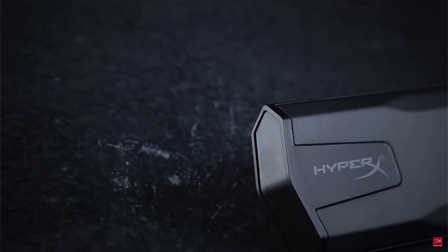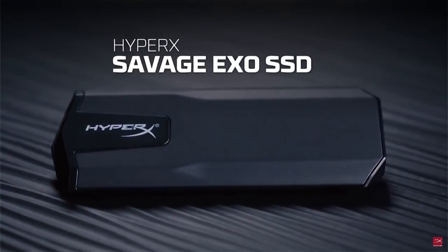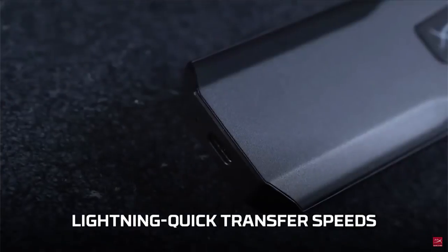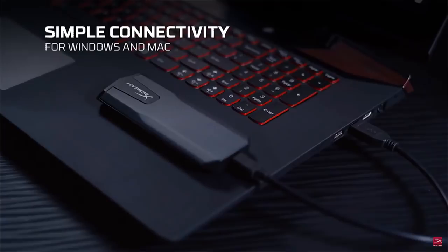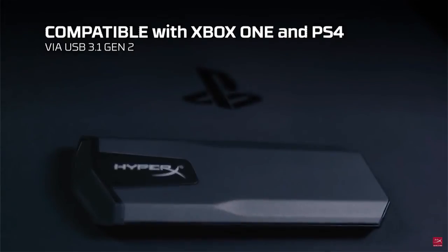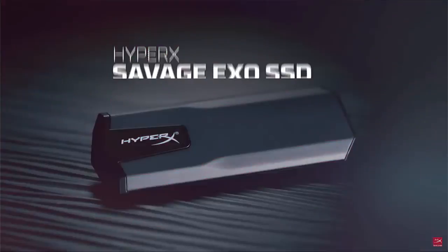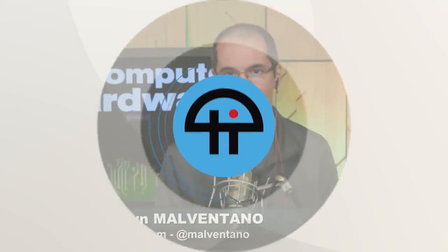So for the moment, it is what it is. Now, plugging it into a console, is that going to be enough performance? Absolutely. Where is a console possibly going to be downloading a game faster than 500 meg per second from anywhere, unless you happen to have a 5 gigabit internet connection, and even then I don't think the console can process the data that quickly. So it'd be fine. Especially if your system only has a SATA internal SSD. Even if you don't plan on using this for gaming, which they're marketing more towards, if you just wanted a portable external SSD, as long as 500 meg per second is fast enough for you, then it'll be fine.